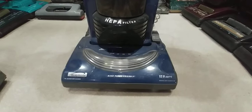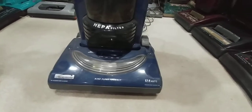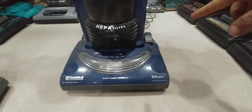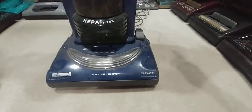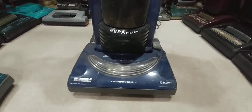At first I thought there was something wrong with the brush roll, but the brush roll was in great shape. Then I saw how much belt material was caked on that lever system — yeah, they were probably just not aware of the damage they were causing.